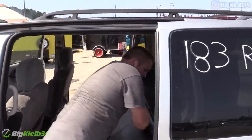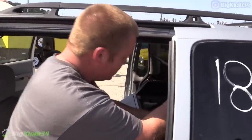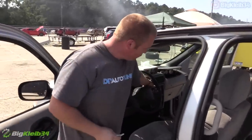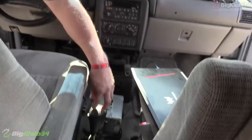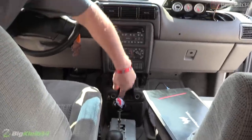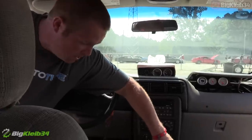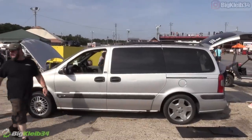So how do those two work together? They actually don't really. It has two separate throttle pedals. The transmission shift — this is the front transmission, this is the rear one. I just put them both in drive. The rear transmission shifts here, and I have micro switches on this little shifter here to run it up through the gears — this just electronically shifts the transmission up through the gears. So I run them both in drive.